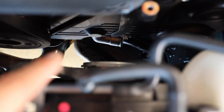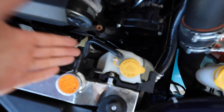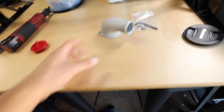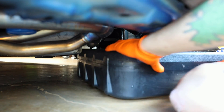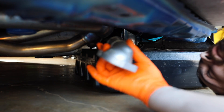On the water pump housing there are two 10 millimeter bolts holding it to the water pump — one on top, one on bottom. Go ahead and pull those two 10 millimeter bolts off and that guy will pop right out. Since I don't have the car jacked up I don't have a lot of room, so I'm just going to pop down there, pull those bolts, get that guy off, and then we'll compare it to the Killer B one on the bench. Two bolts out — that came off a lot easier than I thought.